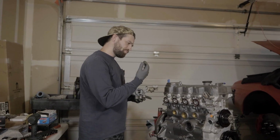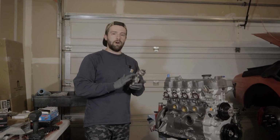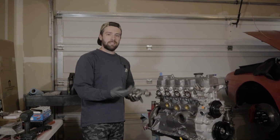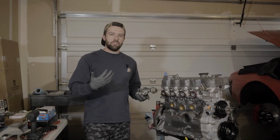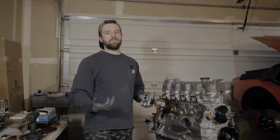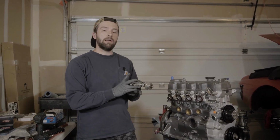It's conventional oil. Some of the ideas behind why you don't want to run something like a synthetic, there's all different types of debates. I'm really just going to go on the fact that I'm working with a guy who's been working on these forever and knows exactly what these take and has pushed these motors really hard, and this is what he said to do, so I'm just going to do it. But the difference between synthetic and conventional, some old wisdom would say that running older engines that had looser tolerances, you want to run conventional with higher weight oil typically. I can't totally speak to that, but that seems to be what that crowd would say, and in this case I am going to run with it.